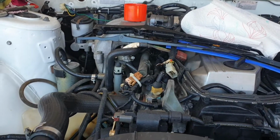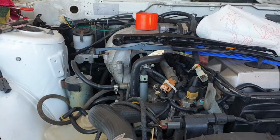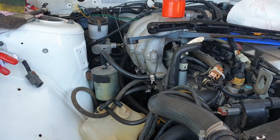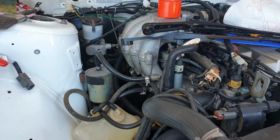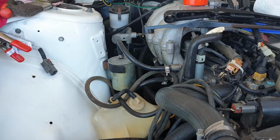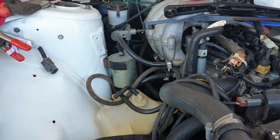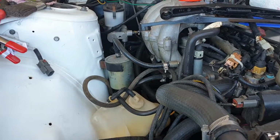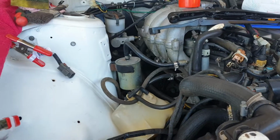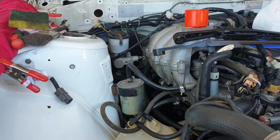There is no knocks, rattles or bangs. It does have that standard RB30 tappet noise when they first start up, especially when they haven't been started for a long time. That's normally because the lifters bleed down, especially if it's sitting on the upper lobe on that valve. The lifters will bleed down, and they do tap tap tap for a little while until the oil pressure comes up. That's pretty standard for these. They all do it. Haven't come across a RB30 engine that doesn't do it.